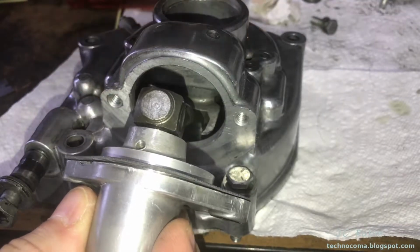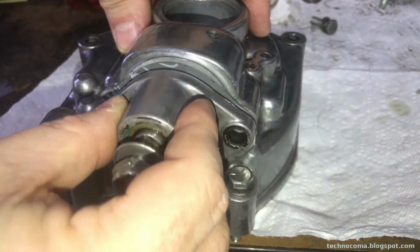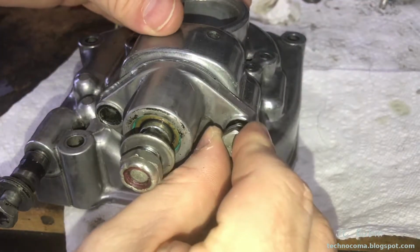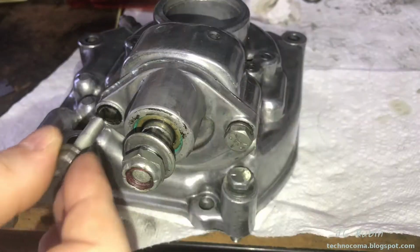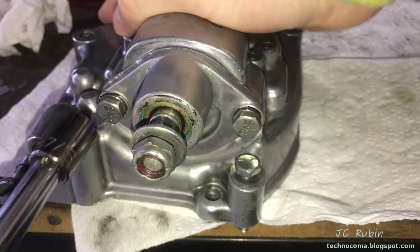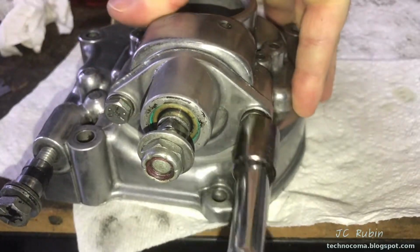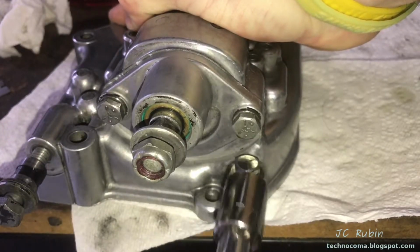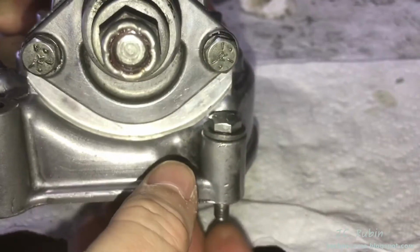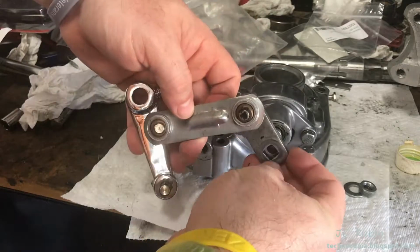This bolt will be placed in, so I don't forget. Now I'll reinsert this piece in between that slot and push up this portion into this hole here, keeping the gasket straight if we can. There we go. Reinsert our screws. I'm tightening these progressively to 120 inch-pounds. As we can see, this screw is now permanently stuck in here as it should be.